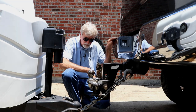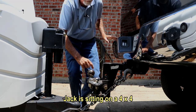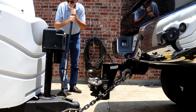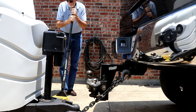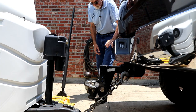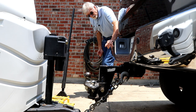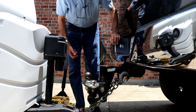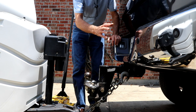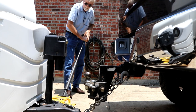I hit the bottom of my tongue jack so I can't go any lower. I'll go get my floor jack and we'll jack it up all the way. Let's come all the way down and see where we touch first. By the way, if you try this make sure your leveling jacks are up. It looks like it's sitting as designed, but that's awfully close to the pavement. I think when I hook back up I'll put a couple of twists in the chain. As long as you don't have that emergency cable pulled and you still have trailer brakes, I think that's the best scenario.